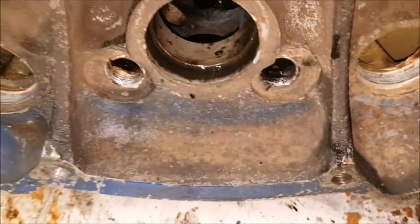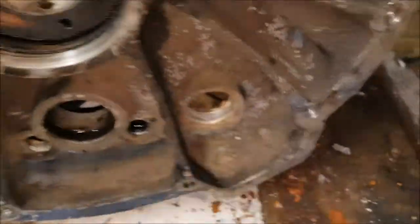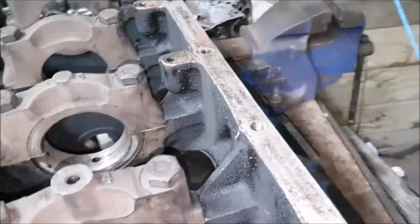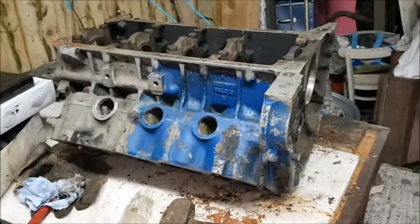I've removed the big blanking plate that goes over the end of the camshaft gallery. All of the little core plugs have all been renewed now - every single one of them is out. There were a couple that were dodgy, three, but on the whole they were okay. I've cleaned up the bearing caps and they're all back on again now. I've also knocked out the old dipstick because the dipstick tube was broken at the top end - it comes out of that hole there. I found it's easier to cut the top off flush and drift it through.